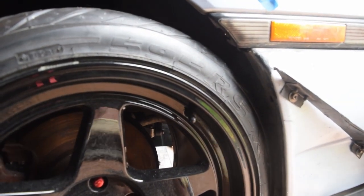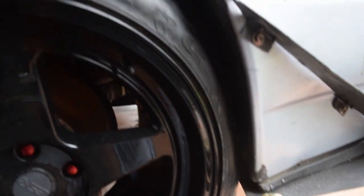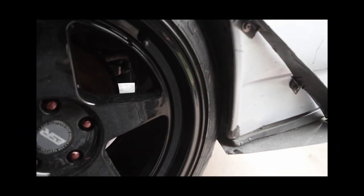When we go the other way we hit the same issue, and unfortunately I had a little fear of this. We're too close to this metal, which means we need to trim this even more which I don't want to do at all. So what we're going to do now is take the wheel off, take off the fender liner on the inside, refit the wheel and see where that leaves us room wise. A lot of the way we're working at this is doing one step at a time with minimal adjustments so that we're not overdoing something and creating more work later down the road. So let's start by taking out the fender liner.